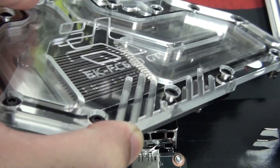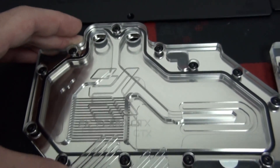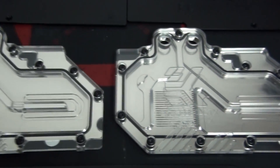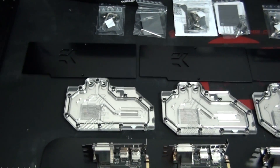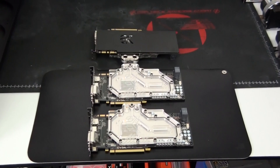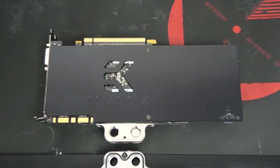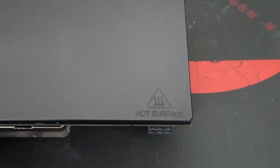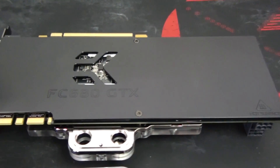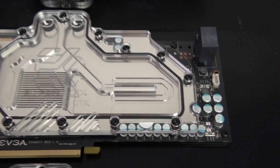It is still multi-choice and EK puts up the options, but there's a fairly wide range. The reason I'm not using CSQ graphics card water blocks — to match up with the rest of the CSQ water blocks in this build — is because I want to set up a Crystal Link configuration in parallel between the graphics card water blocks. With the CSQ design, that's just not possible because of the restrictive inlet and outlet options. EK has recently come up with a solution for this, visible on some of the Titan water blocks. With the old design you have two inlets and outlets on the top and bottom of the water block, giving you a whole lot more freedom and allowing you to use basically any multi-GPU water cooling fittings.